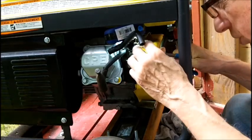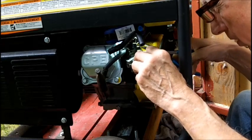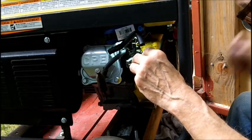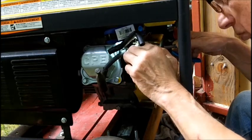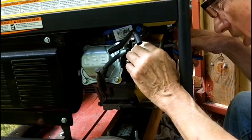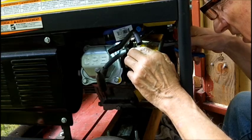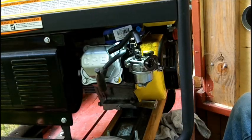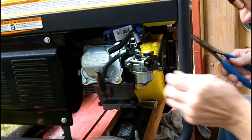Get the spring off first — I think that's what you've got to do. They make it look so easy on their videos. It's not easy — I don't care what anybody says. Maybe you're supposed to take the bar out first. I certainly don't want this to become another one of my failures. They said to pull it out halfway according to the videos I've been watching. The bar ain't coming out — the spring is driving it back. But I can't get the spring out without grabbing it and bending it like that. Because it's got a hook in it, I've got to bend it like this to get it out, and if I do that, that's going to screw up the governor. This is the thing I was worried about — the very thing I said I did not want to touch.